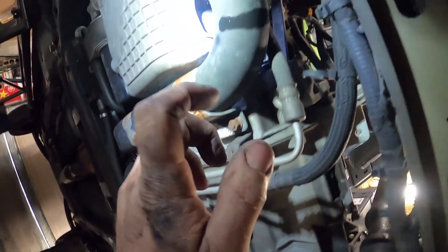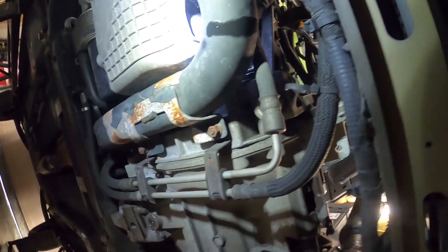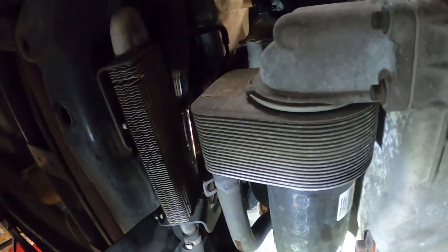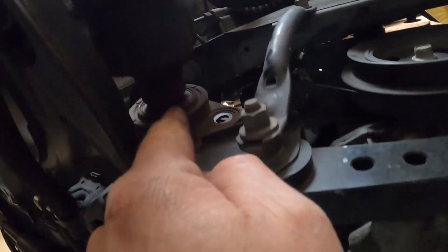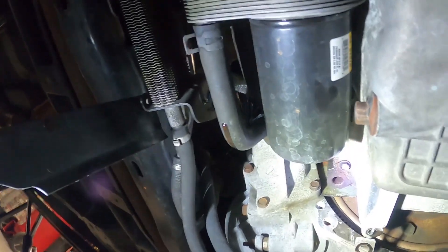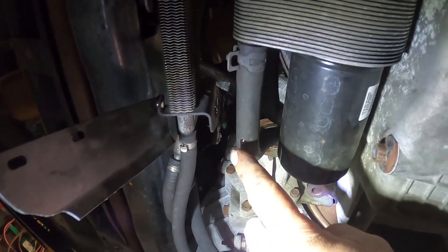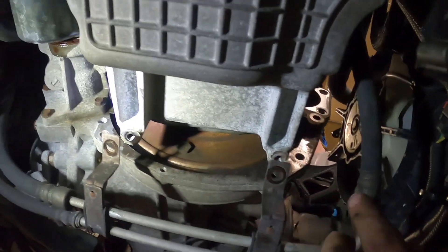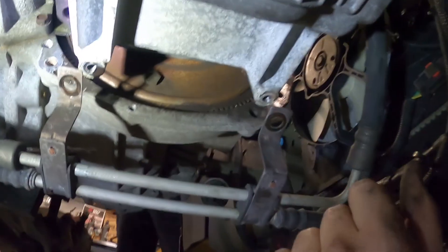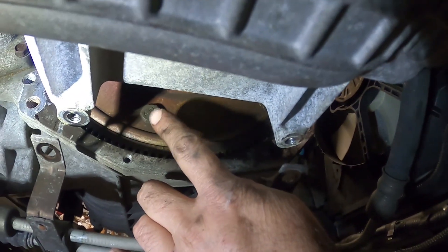We're figuring the fork is going to be pretty shot so we'll see what's going on there. We need to get everything cleaned up before reassembly. Both axles are out - I usually let them lay here so I don't have to pull them the whole way out. You can separate them here if you want. I'll anti-seize the splines in there. There's a little transmission fluid coming out just because the axle's out. All brackets are off, ECM is out of the way, cold side pipe and hot side turbo pipe are out of the way.